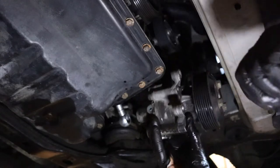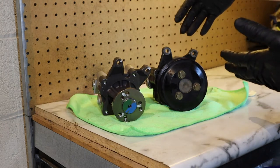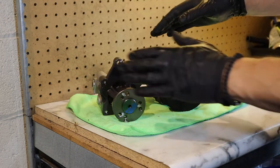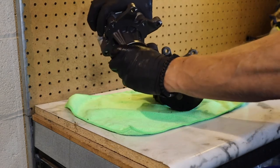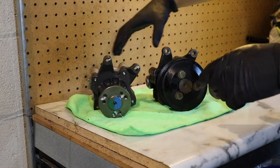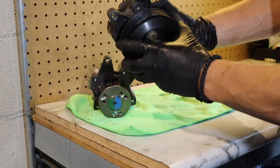And out comes the offending bastard. So how do you know your old power steering pump is bad? It's easy, obviously, now that it's off the car. If you guys watch part five — I'll put a link in the description — you hear a high-pitched screeching noise when you're giving revs and turning the wheel. The new one doesn't have any play when you go up and down. Tiny, tiny bit of play, but minimal. You can't hear anything.